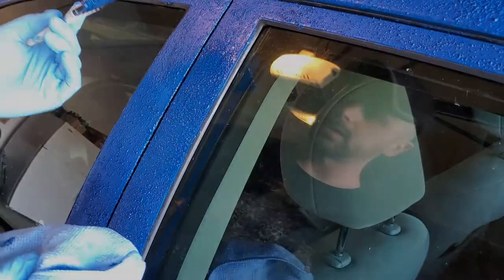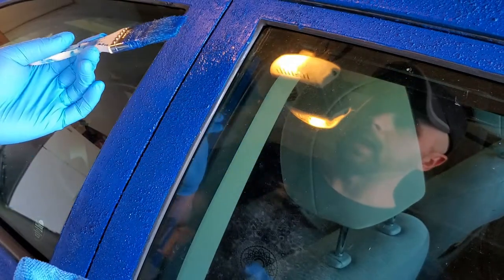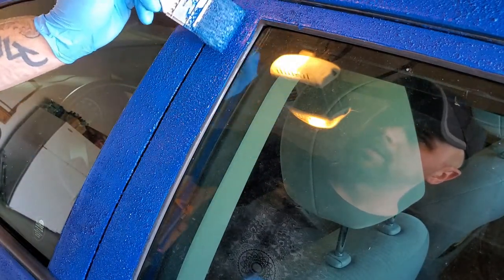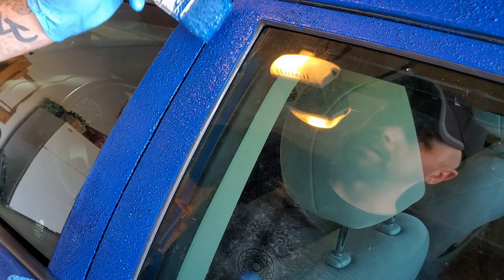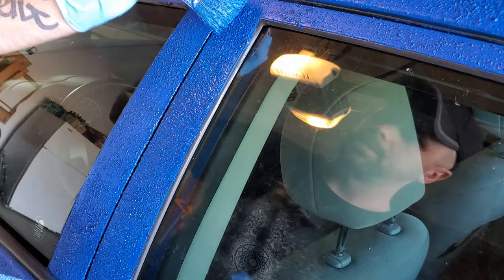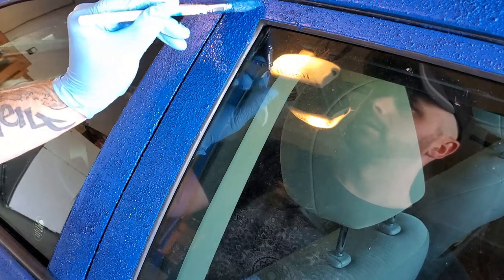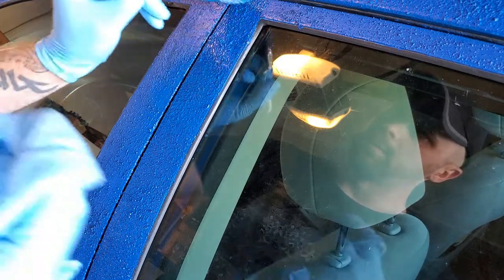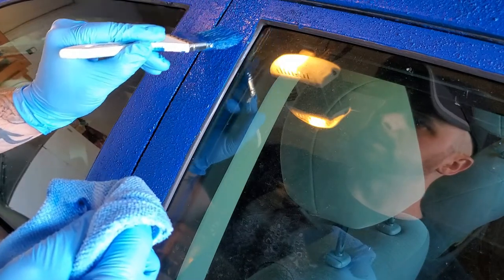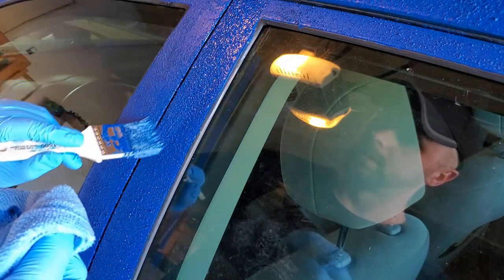So on the website, it talks about using a brush, and it basically says you don't paint, you kind of lay the Durabak in. And that is exactly what I'm showing here. Now, something to remember when you're doing tight spaces like this, remember that you are in control of the texture. So if you see it starting to pile up, just do your best to keep it even